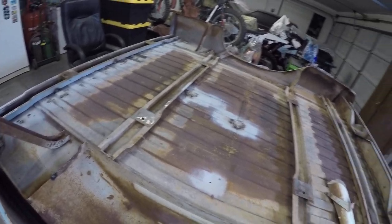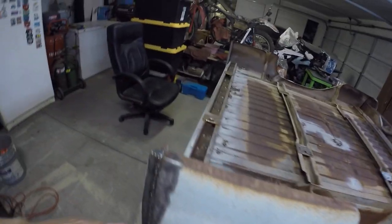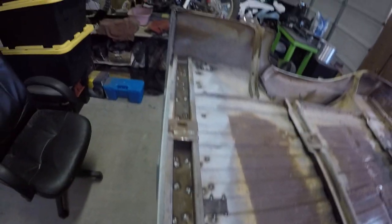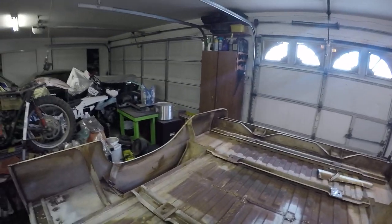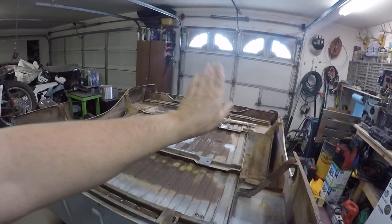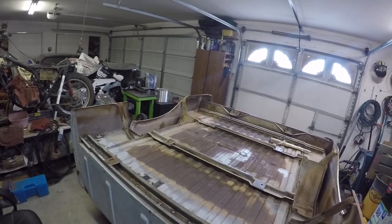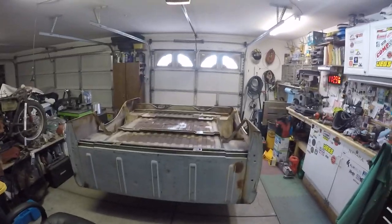That's how I fill in holes that won't fill in easily — this is pretty rusty. It's from 1966, but it's getting there. I'll do a bunch more grinding, a little bondo, a bunch of primer, because all this will rust like crazy — not in Vegas, but it'll rust. So I'll sand all that and primer it all up, get it flipped over, and I've got to do that cut over there for the pre-runner bed cut — what they call the departure angle — so when the truck bottoms out through a ditch, it gives you a little more angle so you don't drag the bed. It looks cool too — it's what they did in pre-runner trucks in the 80s and 90s. That's the progress for now.